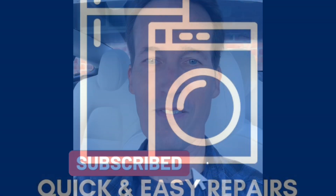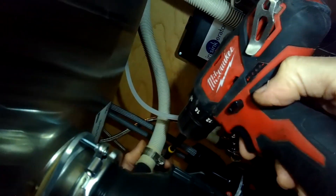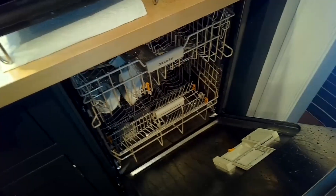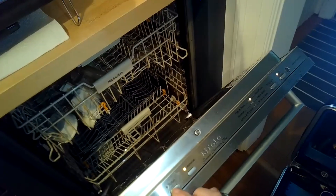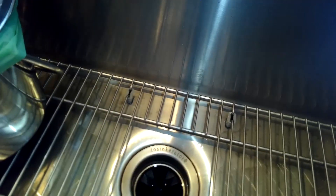I want this to be in a big arc because I don't want water from the sink to fill the disposal and drain backwards and flood the dishwasher. By putting it in this big arc, it's basically doing the job of the air gap but it won't clog up. I'll tighten the hose clamp. You never want the drain hose to go straight from the disposal right into the dishwasher going downward - always route it in an upward arc. I set it for a new cycle, close the door, and get good drain action.